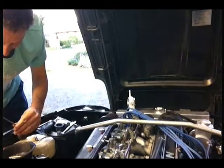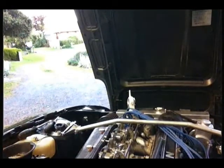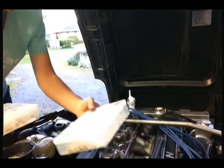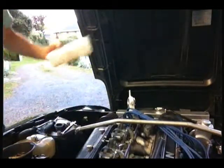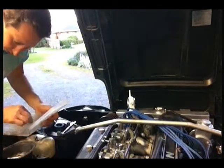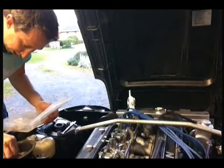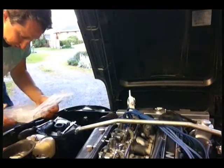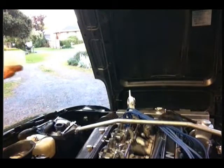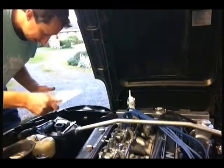So what I'll do, I'll put these 155s away. As you can see, it pays to have a selection of jets as I have here. So air 155s go in here. That's what we're taking out. You try and label it as best you can so you can keep track of everything. 2, 4, 6, you know where everything is. Okay, now we'll go some airs. We've got some 200 airs. Let's try some 200 airs, huh?